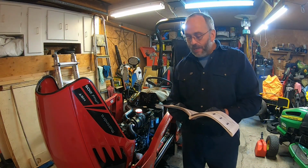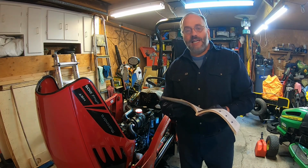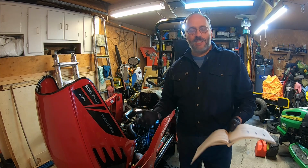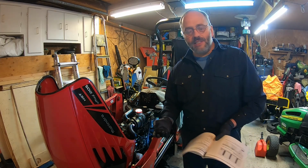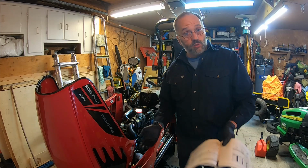In the book, they say replace every 1,000 hours or 12 months. It depends on the conditions. I've seen fuel filters getting very bad after not even 6 months because the fuel was not in great quality. Here in Canada, we have a great fuel system. It also depends where you get your fuel.